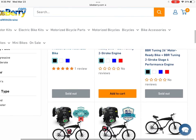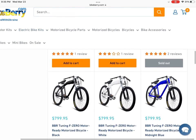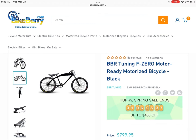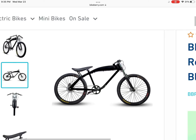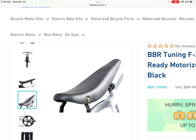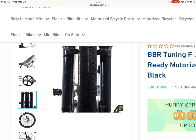Now we're going to look at what I believe is a felt faker frame called the F-Zero. You may have seen this in other YouTube videos. It is a sturdier version of what we just talked about — it has a thicker aluminum frame with bigger welds, high quality Maxxis hookworm tires, along with a cooler banana seat and lower bars. One thing I definitely heard about this bike is the seat is very uncomfortable, and the front sprocket is actually too big. So when you mount your engine onto the frame, it kind of hits your clutch cover and then you're basically screwed — you've got to change out your chain ring. I think it's like a 42 tooth, which is quite large for a motorized bike.